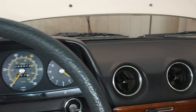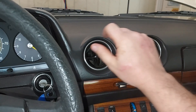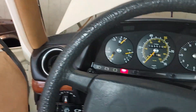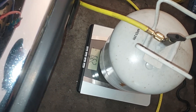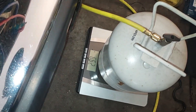See how our AC feels now — oh yeah, ice cold! Ice cold AC, compressor is working. We want it to be about 30.1 — we're at 29.9, so we got like 0.2 of an ounce over which is fine. That's pretty close.